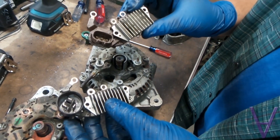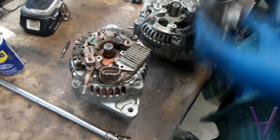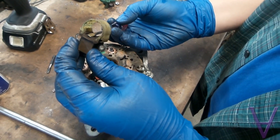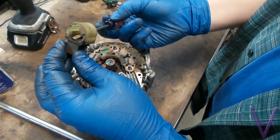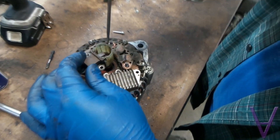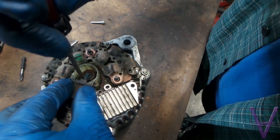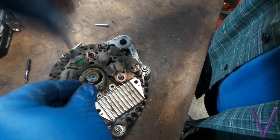We're taking our 20-valve plug and moving it over to the 16-valve alternator so we don't have to cut into our harness. We're going to take advantage of the fact that they use springs and push these brushes in and slip it over that shaft. So we come in from the top with a little screwdriver, slide it back, lower it down, and pull it out.